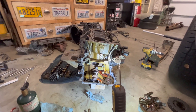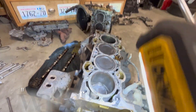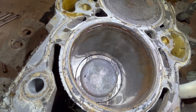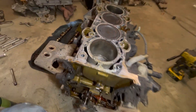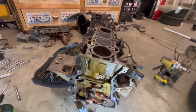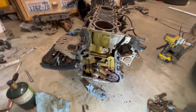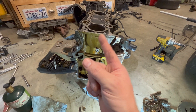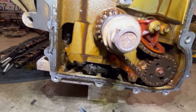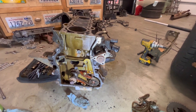So let's see what's wrong with this engine. When I got the head off, I noticed there was a little bit of wear on top of the cylinder - kind of indicative of something touching the piston slightly. All the other cylinders look fine. Then I turned the motor over to see what the cylinder walls look like and it didn't move. The connecting rod is totally broken in the front cylinder. You can see pieces of it there - there's a piece I tried to fish out but it got stuck. This is going to be a core engine for the 5.3 I have over on the floor.